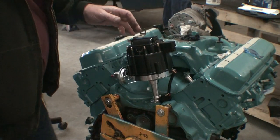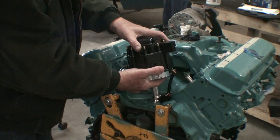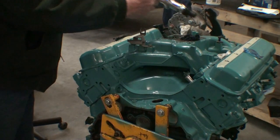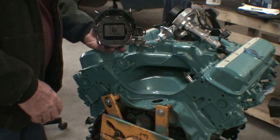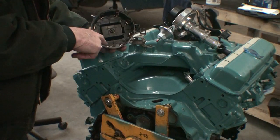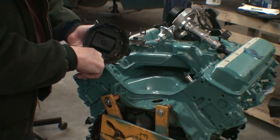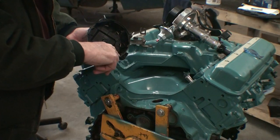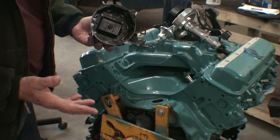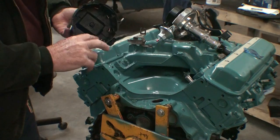I'm gonna take the distributor out, then take the cap off — but I don't want you to see the clues yet, so we're just gonna set the cap aside. When I was a kid one time a car was misfiring and we couldn't figure out why. We checked all the wires and everything was right. I looked in the cap and there were carbon trails — I don't know how they get in there, but there might be a carbon trail burned right into the cap, grounding to the outside of the manifold. Or there might be a carbon trail that goes to the next plug. On these old cars, look for carbon trails and make sure the contacts in there are clean.